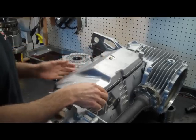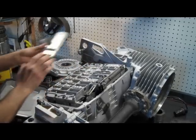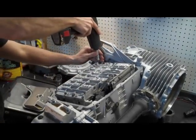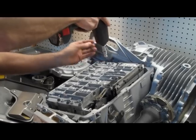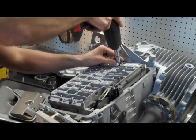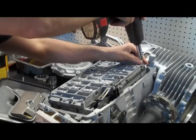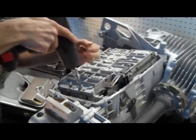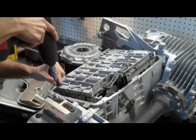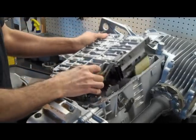You're going to drain the pan in the car and remove it. Remove the filter. This valve body is real easy — it's easier than most. You're going to have several T30 bolts that you're going to want to remove. And that's it — it just will come right out.